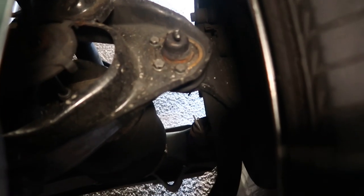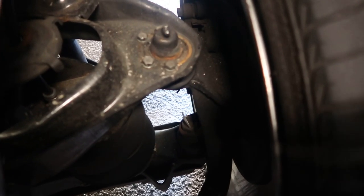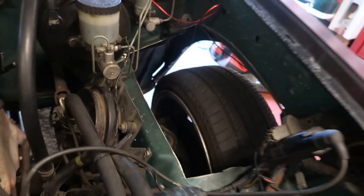I don't recommend this, but for purposes of what I need it for, it works for me. I'm not sure if it's safe or not but I wanted to try it. So the purpose - I flipped the upper control arms and flipped the ball joints - was for when I lay out, when I completely air out. Once it's laid out, the wheel will tuck in more, so there'll be more camber when it's laid out, not when you're driving. There's not a big difference unless you're laying frame. But on this side I did it as well. Since it's not cut out like the other side, it's not letting the wheel completely go up and in because the wheel well is preventing it.